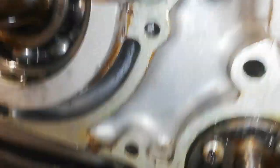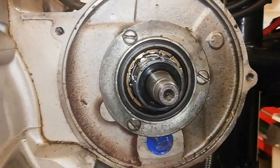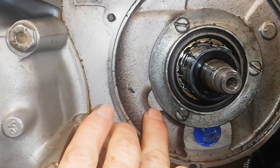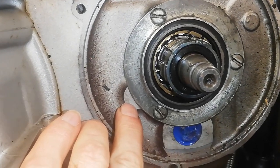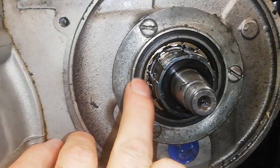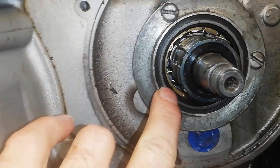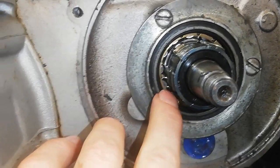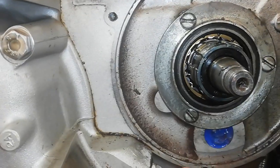That's the boss for the back end of that shaft. There's an oil seal here which runs on the gearbox sprocket and stops oil coming out of the back of the gearbox. Obviously I can't heat the casing up because I'll melt the oil seal, so I'll remove these screws, take off the oil seal carrier.